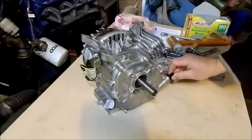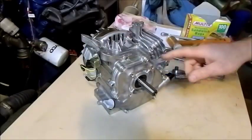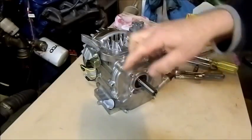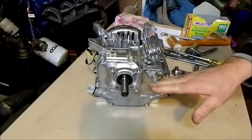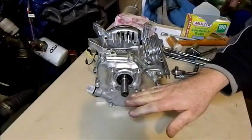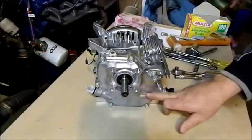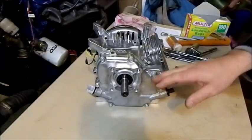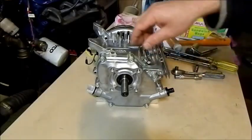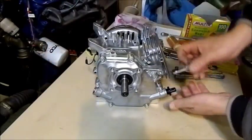There's a filler plug here and a dipstick here. There was also a dipstick on the clutch housing — there are two levels of oil. The clutch obviously has to have more oil in it because it's higher up. The engine on the other hand only has to have oil down at this lower level. Both use 30-weight engine oil.